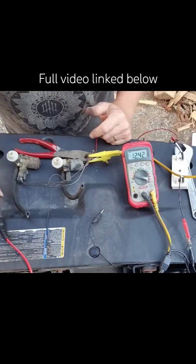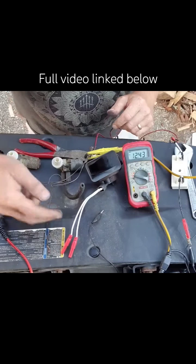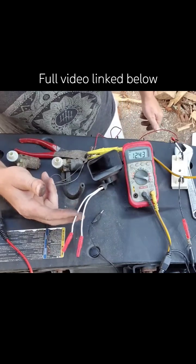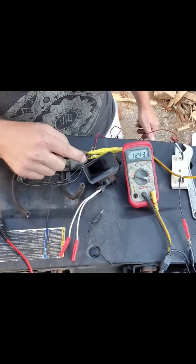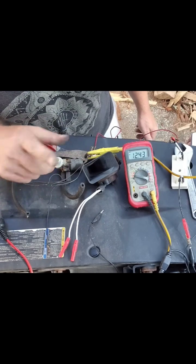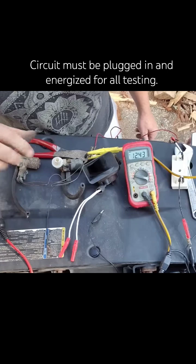You're also not going to have a faulty motor and a wiring problem at the same time. And if you do, you still accurately, 100%, called the faulty motor with the test you're doing — whether it be a voltmeter showing 12 and 0, or a test light lit and not lit. That's an accurate call.